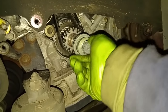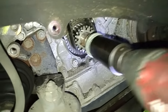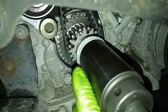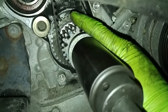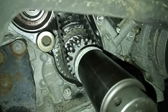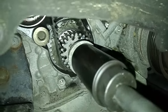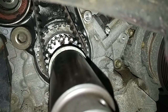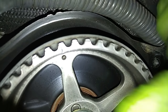We're going to move the crankshaft to top dead center. We put the crankshaft bolt back in place and slightly torque it down. This dot right over here — we're going to move it to this little hump right over there. Now we go topside and see if the camshaft's on the line, and this little notch lines up with this little groove right up here.